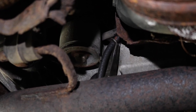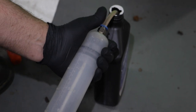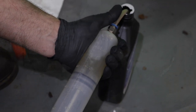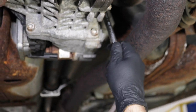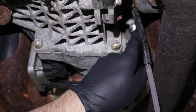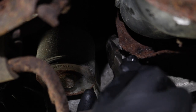I'm going to take a piece of rubber hose and install it where that vent hose goes — that way it's a little bit easier to get fluid in there. Now I'll take a fluid transfer gun with the appropriate clutch fluid and attach it to that hose. This is how you install the fluid, and the reason you do this is because there are different valleys inside here that the fluid won't reach if you just install it through the fill hole. We're going to do this until the fluid starts coming out the fill hole, then take the vent hose and reinstall it on the fitting.